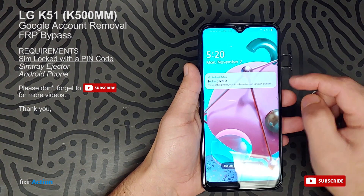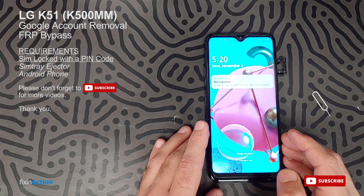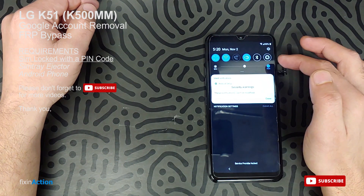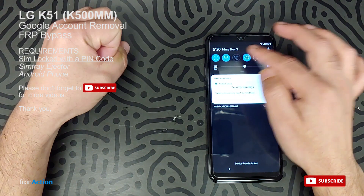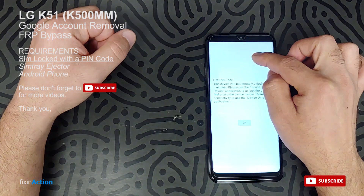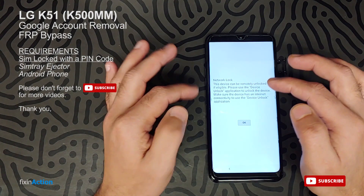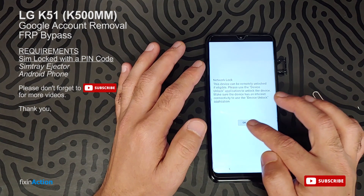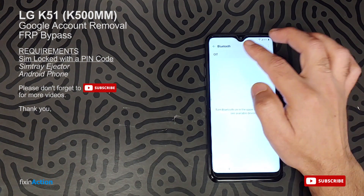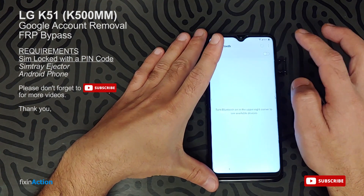On the lock screen over the phone, press and hold on this 'Enter Setup' area. You will see a menu from the top notification bar — press and hold the Bluetooth icon and it will open up a Bluetooth screen. This SIM card is also network locked, so you'll get a message — just click OK. Once you press and hold, the Bluetooth settings box will open, so turn on Bluetooth.